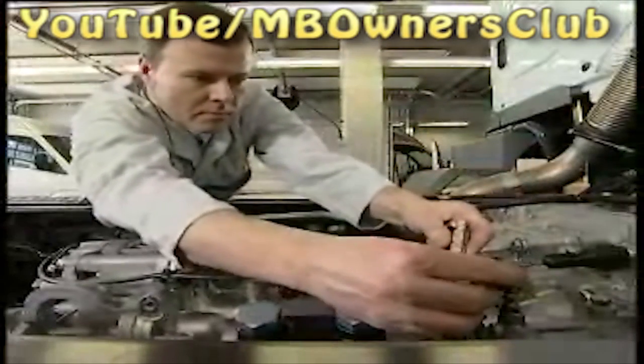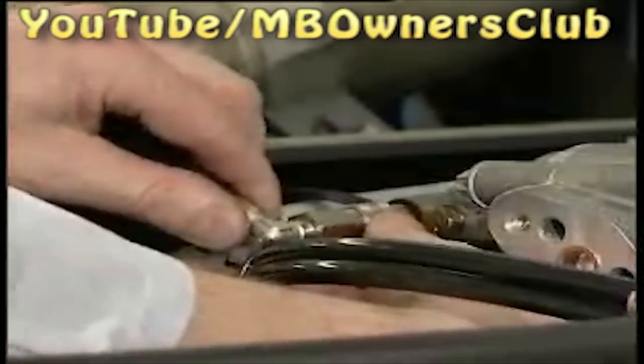The gear shift must be moved at least 10 times to the left and right and forward and back. If the gears are not exact, or the change is too soft, or both, then the gears must be aired once more. Only after a successful bleeding is the bleed hose disconnected — don't forget to put back the protective caps.